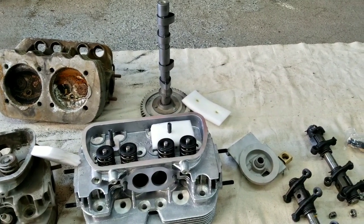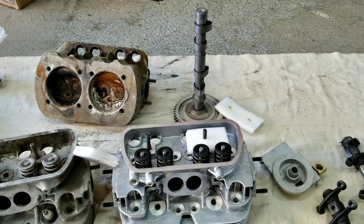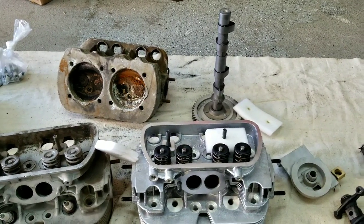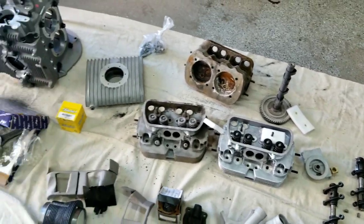We're not going to put a lot of carburation on it. We're going to go with really low carburation so we don't blow up our transmission, because we do not have a built trans for this. It will work as long as I don't just punch it. You just don't want to drive like that — you're going to be putting a trans in it if you have a big two-liter motor.